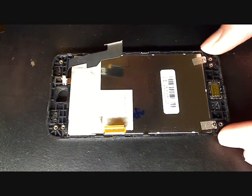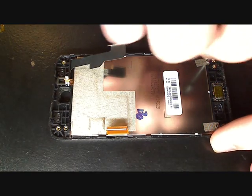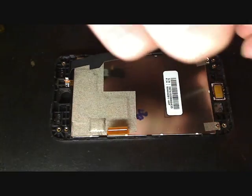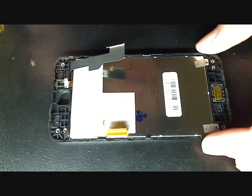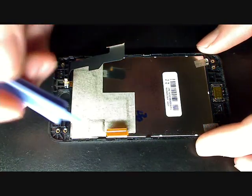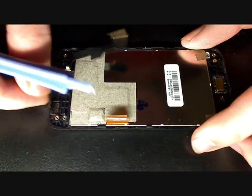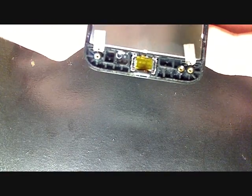The next step is going to be a little more difficult. You've got two screws — go ahead and take them out with your Phillips screwdriver and put them on your magnet. This is the LCD right here, and it is actually held in with double-stick tape that they use to attach both the LCD and the frame together. The tape is extremely sticky and you're going to have to use either this tool or your fingernail to remove it — it's difficult. You might think you're going to break the LCD from all the popping sounds you hear.